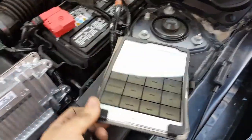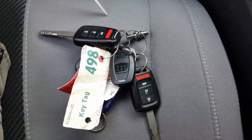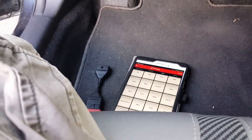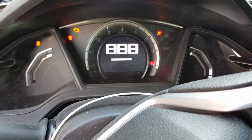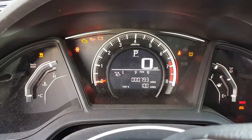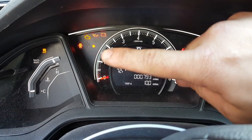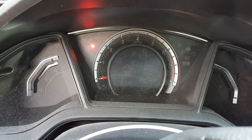I'm gonna go ahead and replace the computer, then get inside the car and start programming it. I went ahead and replaced the computer — this is our old computer. Now I'm gonna hop in the car and program my new computer to my keys, because the car will not start. I'm gonna demonstrate — I just replaced the computer, my scan tool is still on the floor, not hooked up. I'll go ahead and start the car to show you it runs for just a few seconds and then goes off. You can see the red light flashing next to the turn signal, which tells us the immobilizer is active — it's not recognizing the keys.